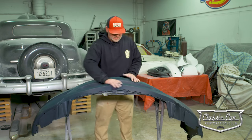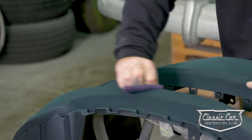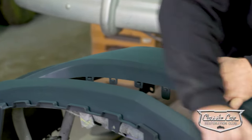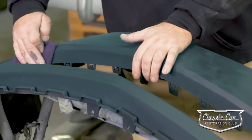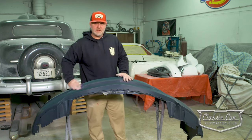That'll help ensure you get great paint adhesion. After you're done scuffing, you're going to want to clean it with a good surface prep, then apply a plastic adhesion promoter, then tack rag it, and then you'll be ready for your final process of base coat and clear.